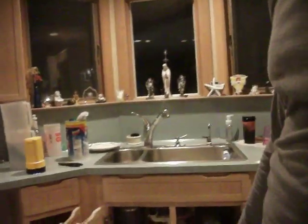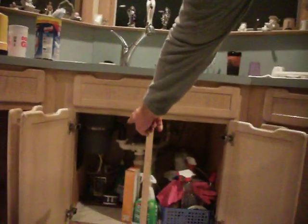But make sure you kill the electric. You get rid of the water, you release that nut, so you get rid of the water supply. But you gotta turn off the water too, which I covered in my first video. Turn off the water, release the water supply through a 5/8 wrench, and then you can check the hose. If it's not the hose, then you got to look into the motor on the dishwasher and see if that's actually working. If that's working too, there's also a valve inside the hose that you got to check, but that's usually not the cause.